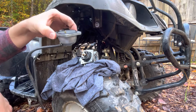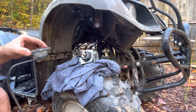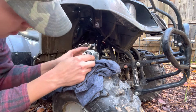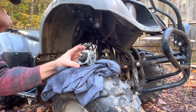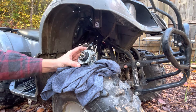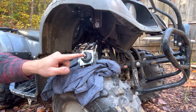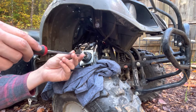There will be some leftover fuel, so just make sure that you dispose of that the best way you can. The next thing I'll do is pull these two jets out so I can unscrew them and then spray them out with some carburetor cleaner.